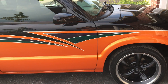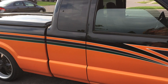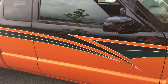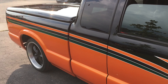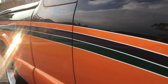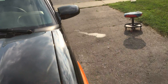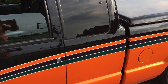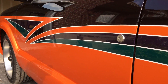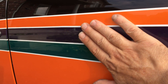It took us about three months to do this in the shop, which was pretty cool. After we did the initial stripes and the first three coats of clear, we let it sit for a few days and then wet blocked the whole entire thing. Then we put three heavy coats of clear on it and wet blocked it with 800, mostly over the stripes.